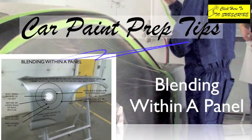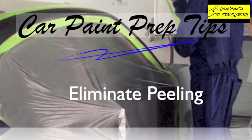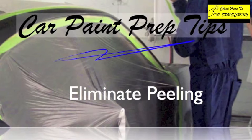When painting, a red scuff pad works. You can use a red scuff pad to get the hard to get areas, your edges, and things like that, but that is a little too coarse. You'll see those scratches through where you're clear coating. So where just clear coat's going to be applied, you can use a gray scuff pad, a gray Scotch-Brite, to get your edges and hard to get areas where clear coat's going to be applied. If you follow these sanding techniques and ensure all the edges are sanded good, you'll eliminate peeling problems.